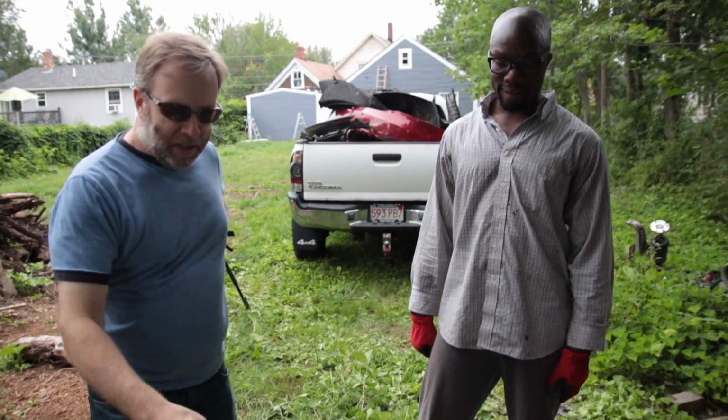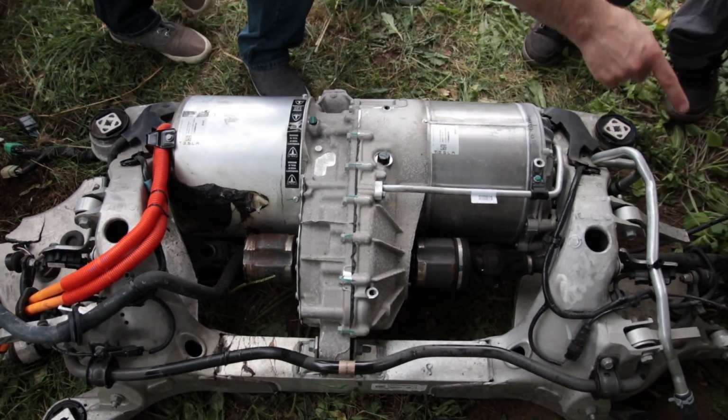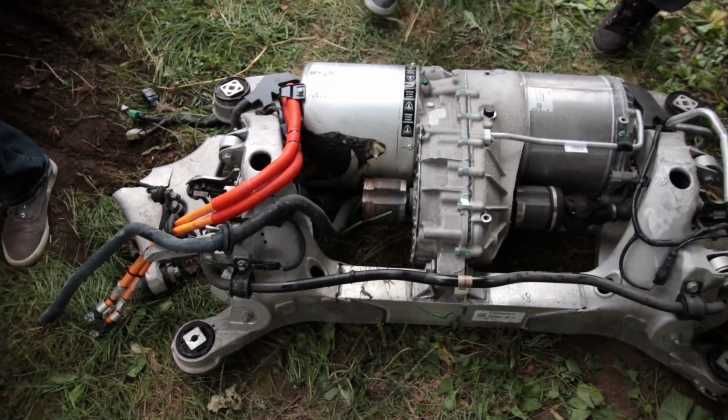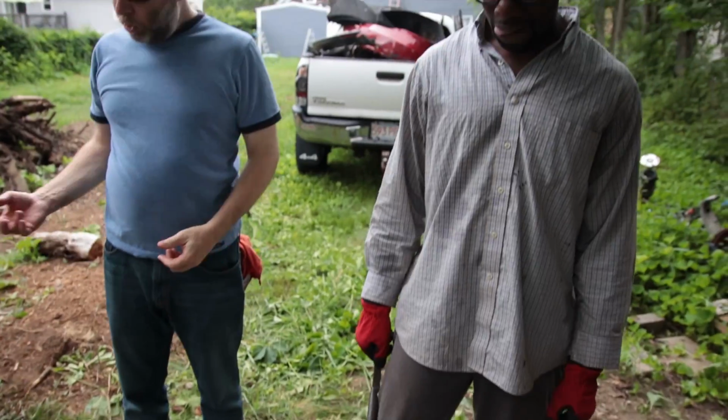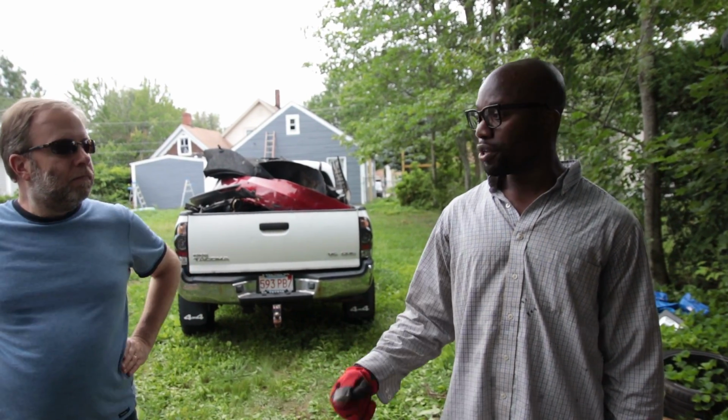And when you were talking about the subassembly, you mean this is the subassembly, so it's only held at 4 points on the car? Yep, and that's how easy it was. Just 4 big bolts holding it. Exactly. Wow. That's why I'm pretty sure Tesla designed it that way, in case they have to do any maintenance to the rear drive unit. That's why when they swap drive units, it's so quick.